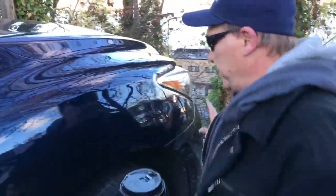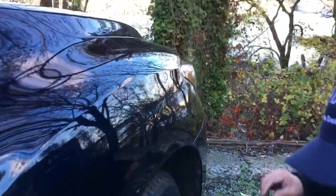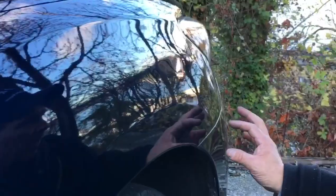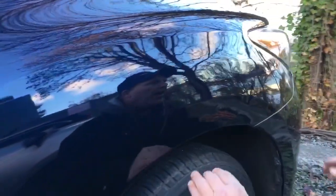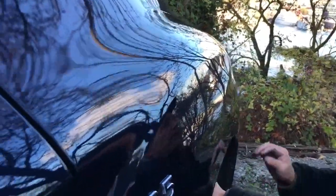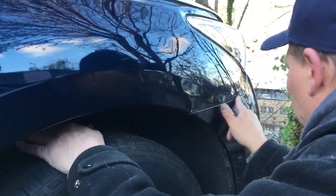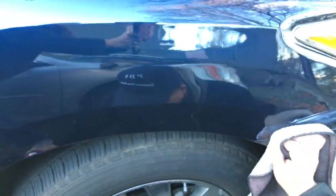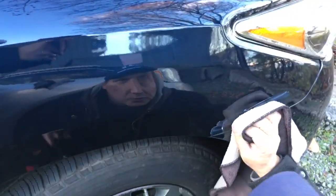Okay guys, we're back. This is what I promised the customer — I know it's not a hundred percent perfect, we've got a little bit of a wave here. I got it all put back together, popped that thing back in. It had a really kind of weird lower dent down here and then it had two big high spots and another one back here. And when I got those out, like I said, there's a brace behind it. I spent about an hour and a half tapping this brow, and I know I'd probably have to spend about another hour and a half to tap it down to get it a little bit more flush. This is a lot of stretched metal here. I still have to buff that little tiny scuff on the side, which I'll do right now — I've been using the 3M — I did a lot of brow tapping with my Shane Jacks.